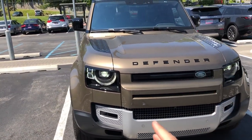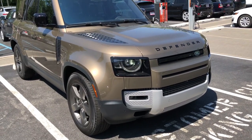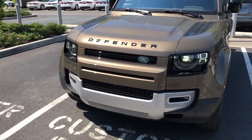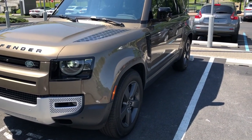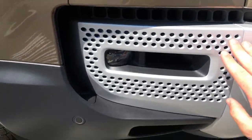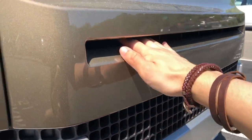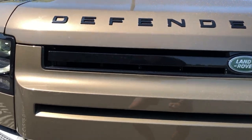This is the P400 powertrain - a 3-liter twin-scroll turbocharged straight-six, Land Rover's all-new straight-six powertrain. It has to be coupled with a 48-volt mild hybrid system, giving you around 394-397 horsepower and 406 pound-feet of torque, which makes it really nice on the road. The four-cylinder option is a 2-liter turbo four without the mild hybrid technology, producing around 300 horsepower. A really good thing about this car is there are no fake vents - everything you see including these side vents and all the vents along the side are real functional air vents.